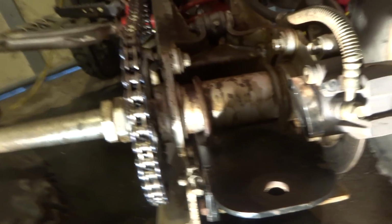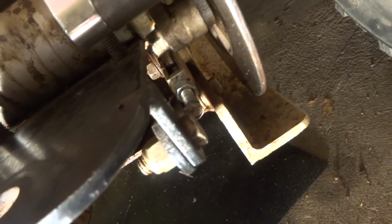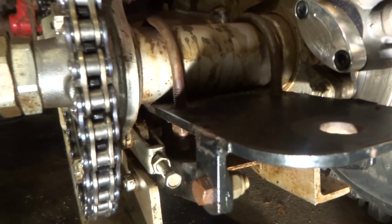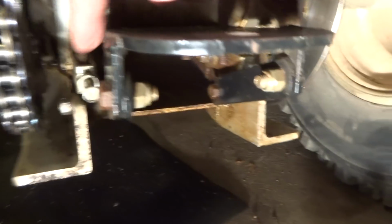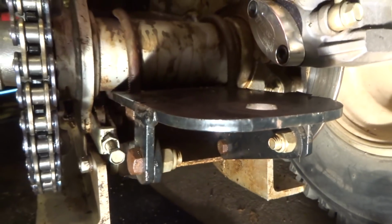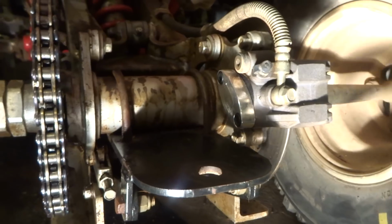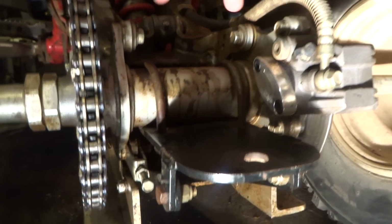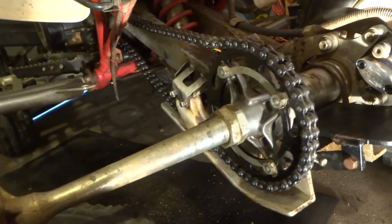So anyway, I got the chain on there and I just need to adjust it now. I'm going to basically just tighten these, make sure they're nice and even on both sides. You can see it's got the exact same little adjuster over there. Get it to where it's got a little bit of slack, and then I'll tighten down these locks here, and I'll tighten down all 4 of the carrier bolts, the 2 underneath I showed you earlier, and then these 2 up above, and the adjusters come all snugged up when I have the chain tension the way that we want it.